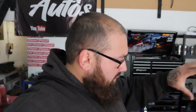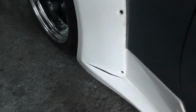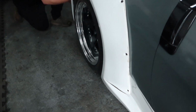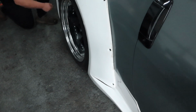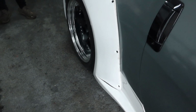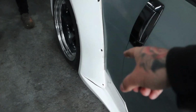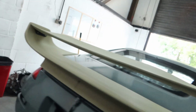Today's video, we're working on the rear arches again. Yes, I know. We talked about it in the last one. But we found all this. Slits here. So what we've got to do, connect this to the car, sort this out. We've got to put some fiberglass here to hold it in position. Then what we've got to do is take the arch off. When it's set, fiberglass the back. We're going to fiberglass fill it in, maybe a bit of dolphin glaze, grind all the front and back off, which is going to be fun. Well, we've got to kind of do that before we do the dolphin glaze, but not the point. So we're going to sort all that, smooth it all in. We're also going to do the same on this side as well.